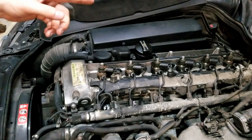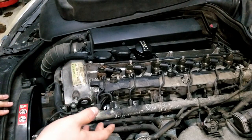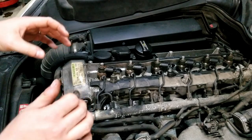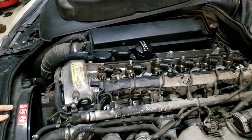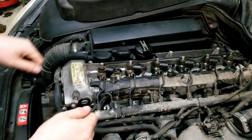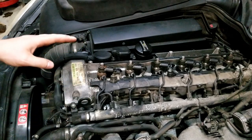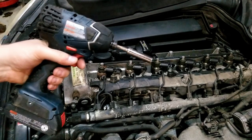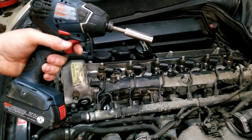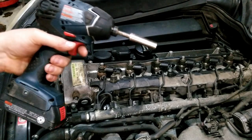I'm only going to be showing one method because it is the most effective. The first method is to set a torque wrench — preferably a small quarter-inch drive — to a predefined value technically set before the breaking point of the glow plug. I've never used this method but it's been discussed by dealership techs to prevent the glow plug from snapping. The second method, my favorite and the only one I've ever used, is a quarter-inch drive electric impact. This generates low torque but relatively high impact frequency — that combination does not generate enough torque to snap the plug but works very well.